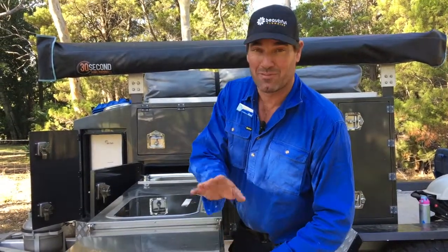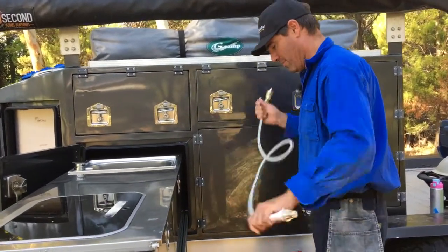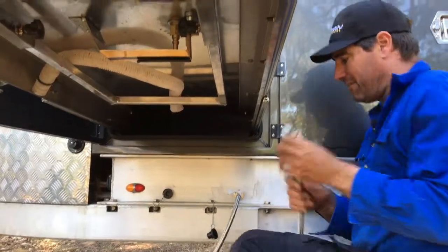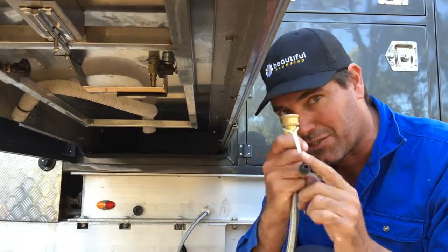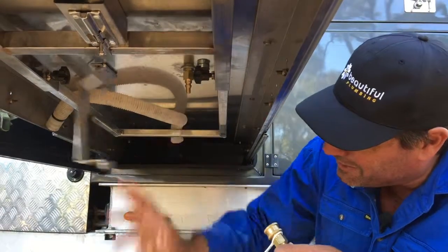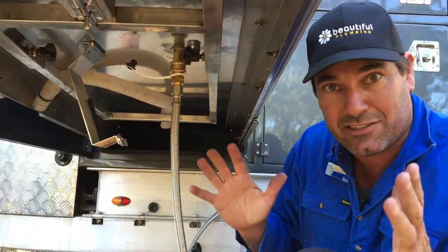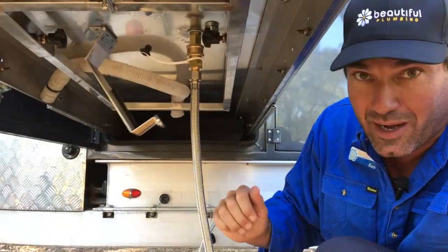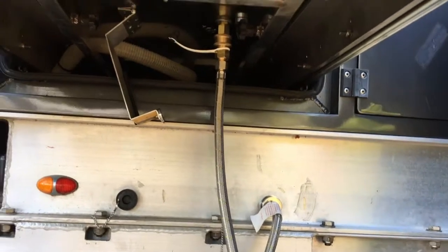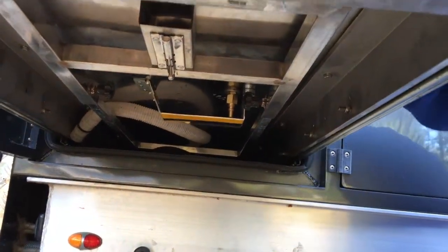I'll show you how easy it is to hook up the hot plate without tools when you're out on the road. Just grab your gas hose, open her up, and down here you've got your dust plug that you take out of your bayonet. Pop the gas hose in — remember there's no gas coming out even with the dust plug removed because it's a quick connect fitting. I've installed the quick connect fitting underneath this safety flap. It's just magnetic, so it pulls down and then you can whack it on. Now the hot plate is connected and ready to use. The reason that safety flap hangs down is: if they start pushing the kitchen closed, the flap will hit and they'll realise something's going on. It's not touching the hose, not going to damage it. All they've got to do is unplug it, put the flap up, and then they can shut the kitchen.